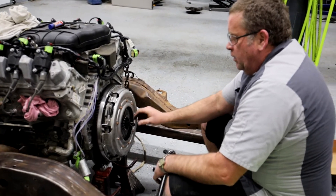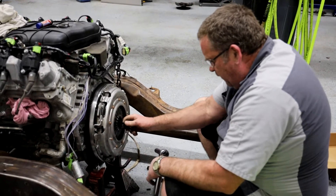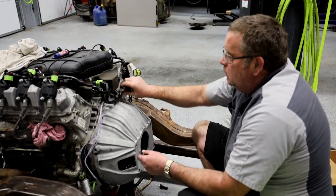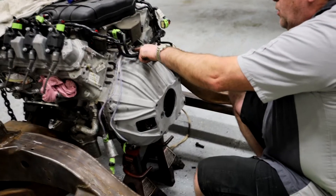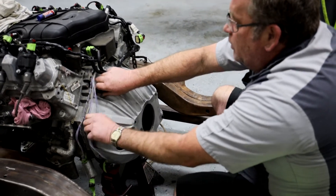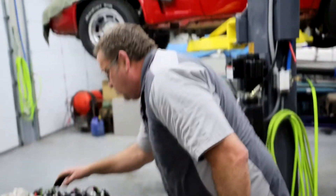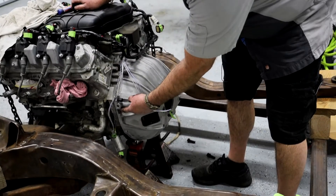The pressure plate is on, clutch is in place, and our clutch alignment tool slides in and out nicely, which means the transmission will bolt up. Now we're going to put the bell housing back on. GM has moved a bolt that used to be right here on their small blocks to up here. We're going to bolt this up with five bolts and torque them down properly. It doesn't take an excessive amount of pressure at this spot — most of the pressure actually winds up on these dowel pins.